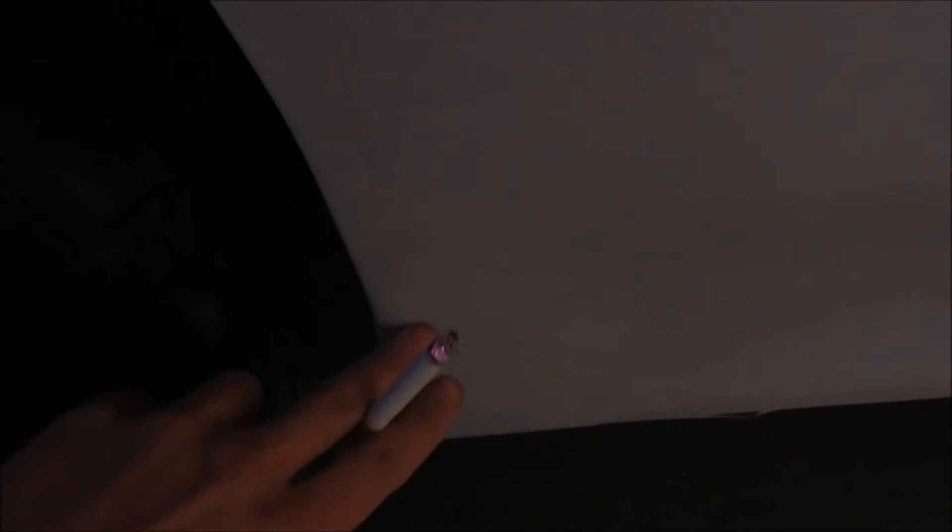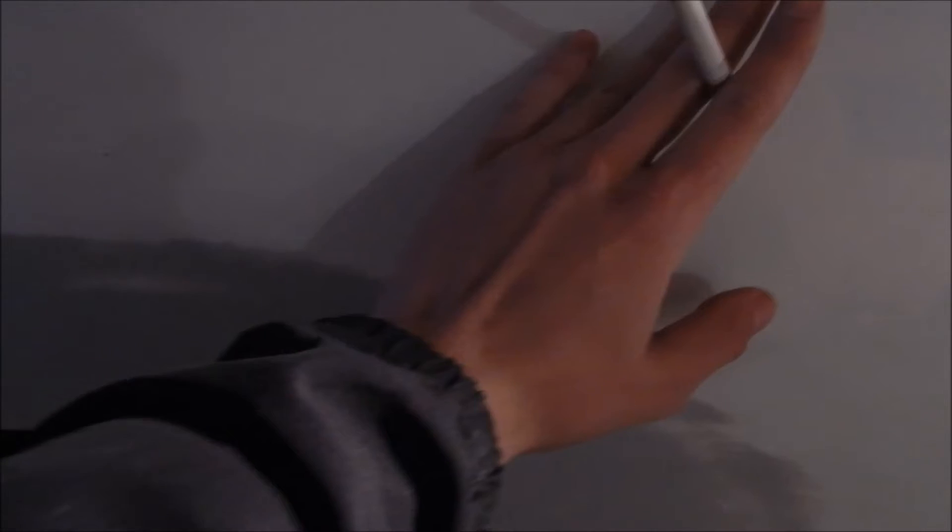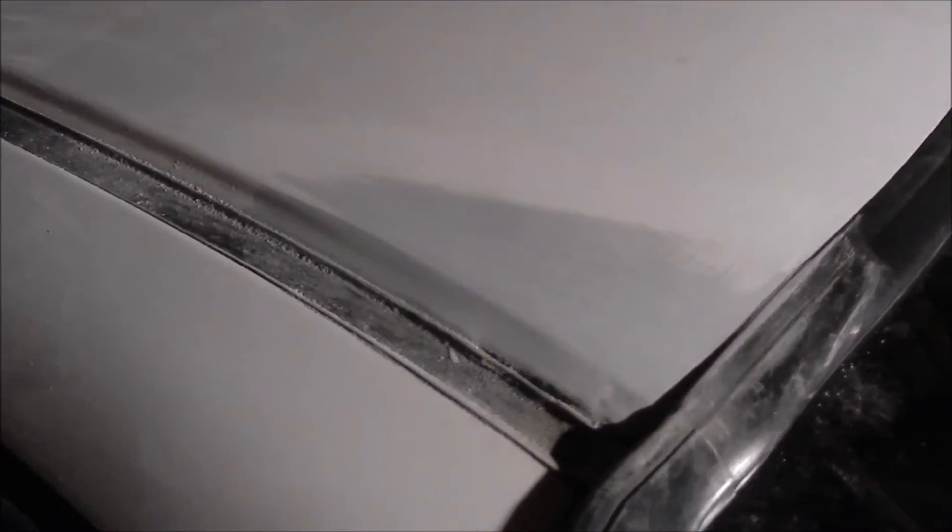I started on the passenger side — there was a decent amount of rust all through here. A little bit of restoration done right here by the previous owner that looked really bad. There's some rust on the inside of the door all along there, so I just primed it, sanded it. It doesn't look the greatest, but when you transition from OEM paint into the primer it's smooth to the touch, so I'm not too worried. Did a little bit up here, a little by the window, some spots near the tail lights, and a few other little spots all through there.